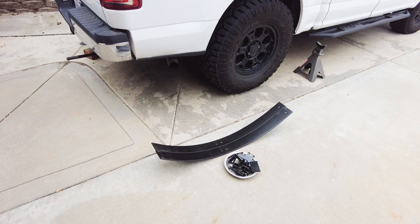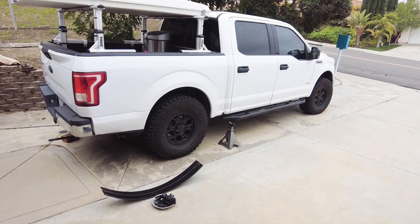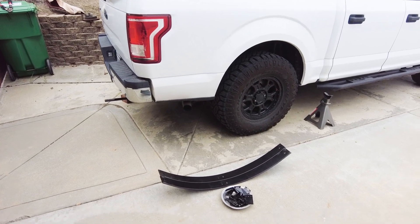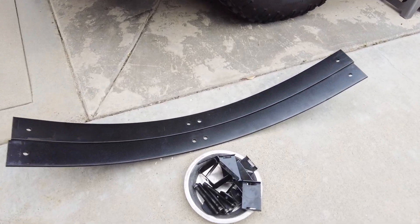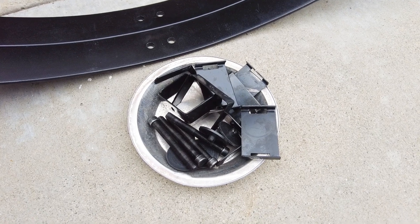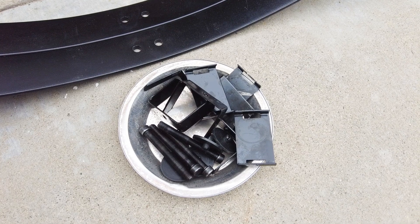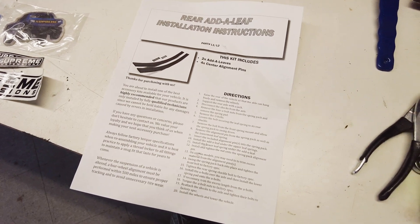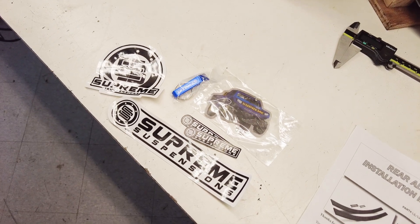Today I'm going to add a leaf to the pickup on the rear end. Once it gets all this weight in it, it sags an inch or two lower than the front. The springs are pretty well used — it's a fairly high mileage truck — so I think this will help. It was only a hundred dollars. The kit comes with the springs themselves, plastic separator pieces, alignment pins, and clamps to put it back together. This kit is from Supreme Suspension and it includes instructions, plus an accessory pack with stickers, a bottle opener, and an air freshener.